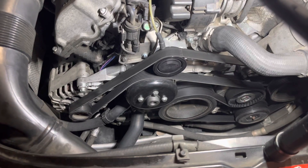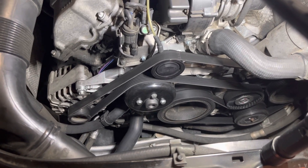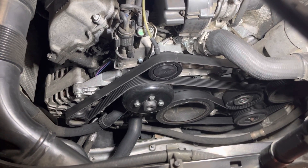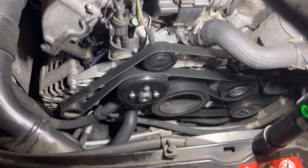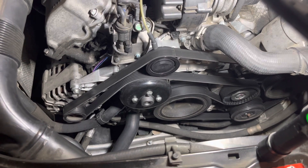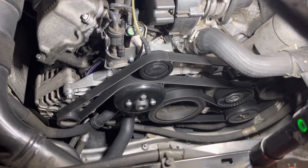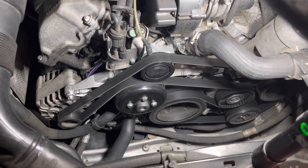I'm going to jump right to it. I already dismantled the check valves and cleaned them as well. You'll notice that one side will be more dirty than the other, but just be careful when you clean it. Try not to put solvents down the check valve neck and you should be okay. You're going to get some debris, some dust, but I figured that's going to be naturally there during the life of this car. Just to be safe, go ahead and crank the engine without starting it a couple of times, just to help dissipate the dust or debris throughout the exhaust manifold.